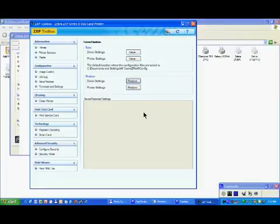There is also a second advantage, when you have a location with multiple printers. You just concentrate on setting one printer with your customer, and again the colors he wishes, how you want to print the UV, the inhibitor, and so on. When everything is okay, save them, driver and printer. Now retrieve them from here, put them on a USB pen drive. Now you go to the next PC and the third PC and so on, and you just restore them from your USB key, and automatically the second printer, third printer and so on will have exactly the same parameters as the first one. So that saves you from doing the job X times. If you have X printers, you just do the job once, and after you repeat it everywhere.